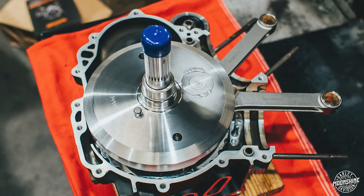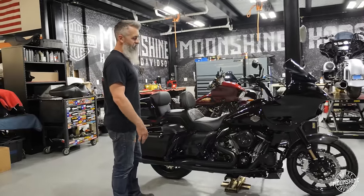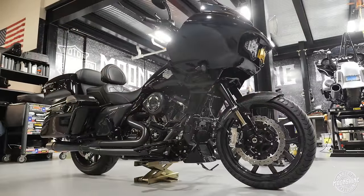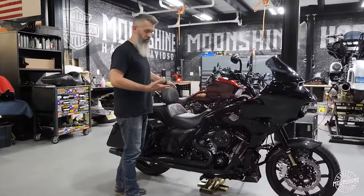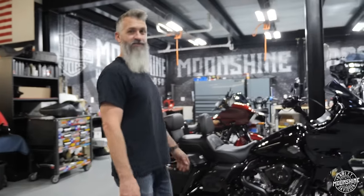If you're new to the videos: fully built lower end, we run the MHP Lightning Rods. This has a Screaming Eagle oil pump and plate. We're running Fueling Race Series lifters, Screaming Eagle adjustable push rods, and a Star Racing full race 615 cam. It is running a pair of our 4.5-inch pistons that have a baby dome on them to get the compression we need for the street. It's got a 2-into-1 Thunder header — we got the OG exhaust on there. Sounds great, ties in really well with the build. We need a larger primary pipe; the Thunder header has a larger primary diameter that allows us to get a little more horsepower on a long exhaust for a big motor ridden daily as a touring bike.